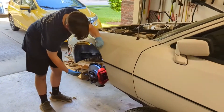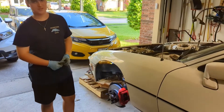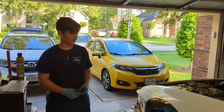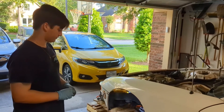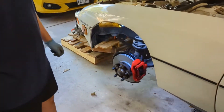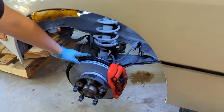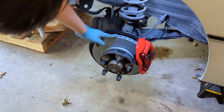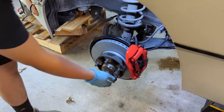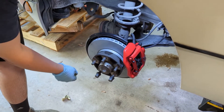Today is day 94. We had a bit of a break and didn't do anything for quite a while, but we're back. Today we took the calipers that had been sitting in a box for a long time, finally rebuilt them, and put them back on. We also spray painted a flat debris shield and installed new rotors. We rebuilt the brakes — same cylinder but with all new rubber seals inside and rubber boots — and painted them red.